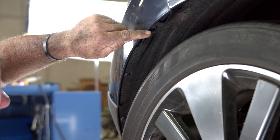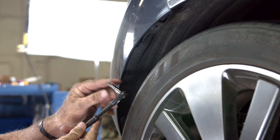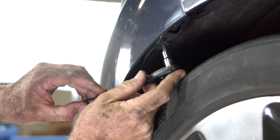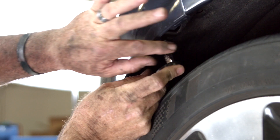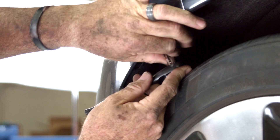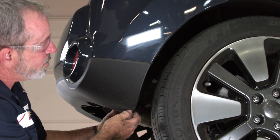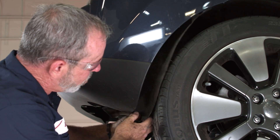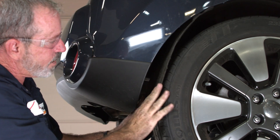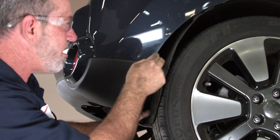Now that we have the three plastic fasteners out on the passenger side, we're going to go ahead and get the three screws. I'll be using a ratchet with a Phillips head on it — you can also use a small Phillips screwdriver. You can see they come out pretty easy; you can almost spin them by hand. Now that we have the screws and plastic fasteners out, it simply just pulls away from the fascia here. We'll go ahead and give you a shot of where the nuts are on the side of the frame in this area.